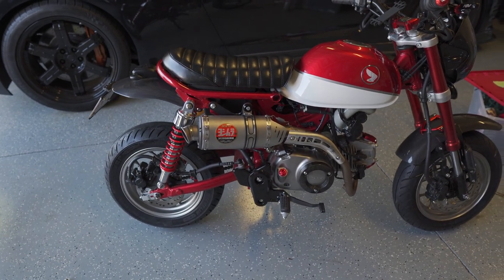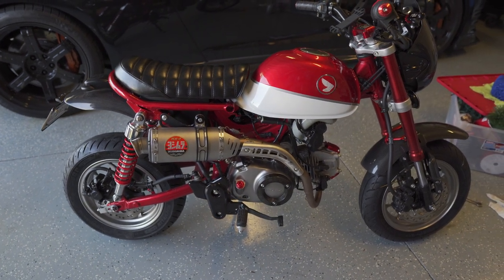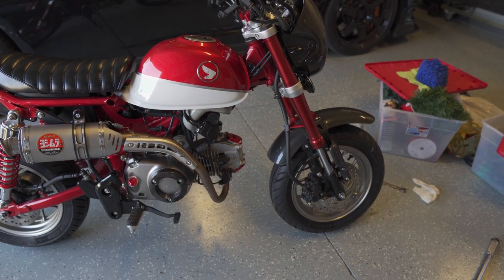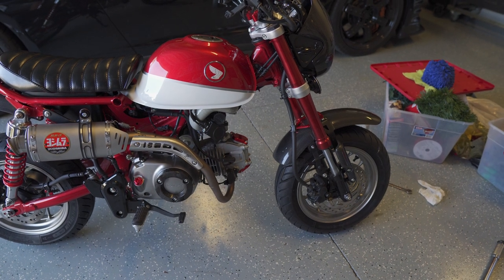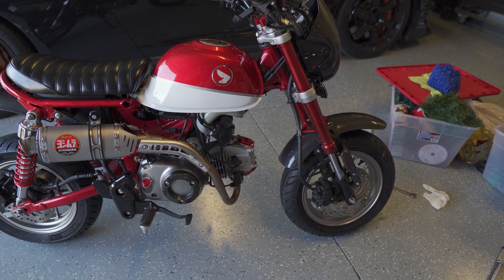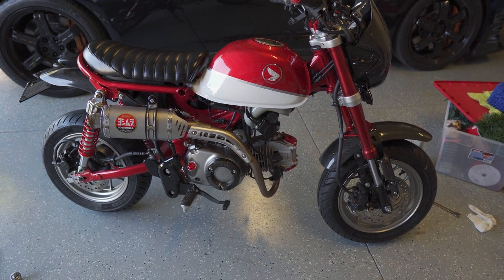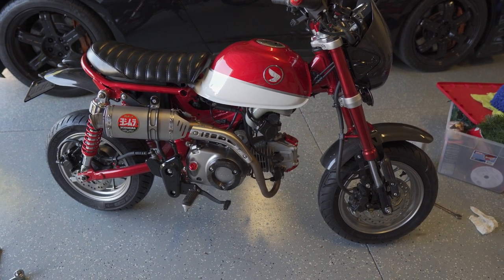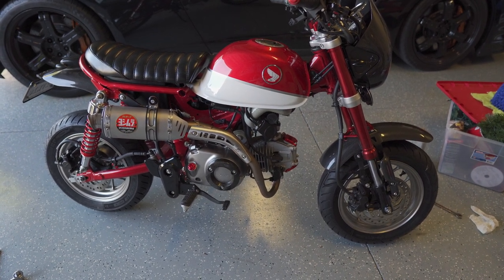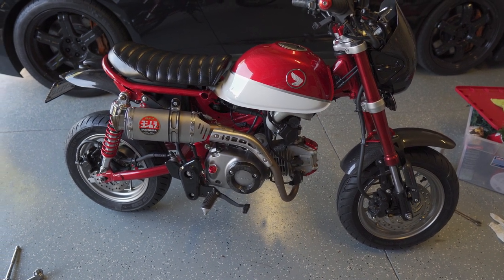So now two things I've changed: one being the 14-tooth front sprocket. You saw in the ride video that the GPS now shows a pretty significant difference with the odometer, and now with these new shoes, that's probably going to throw it off a bit more. So I'll have to do a little more riding and figure out how far off the speedometer is — if it's anything more than a mile or two, I'll go ahead and install a speedometer healer. Regarding the front 14-tooth sprocket, I was really happy with the way that performed. My top speed only got to about 71 miles an hour, but it was actually pretty windy that run. It got up to 71 miles an hour much quicker than it did with the 15-tooth front sprocket.